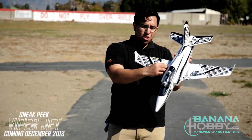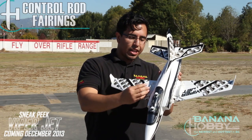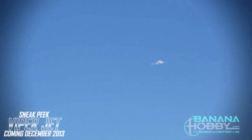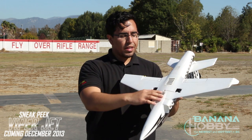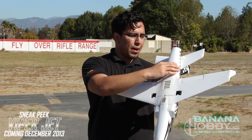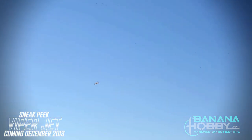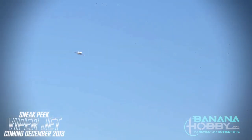We've got some control rod fairings on the main wings that cover the control rods for the ailerons, and that helps out during flight as well. Turning it over to the underside, we can see an air vent for air to seep through, your two aileron servos, and the EDF hatch at the very bottom end. That EDF hatch enables some really nice maintenance features — you can just take off the hatch and access the EDF fan and motor if you ever need to make some changes.